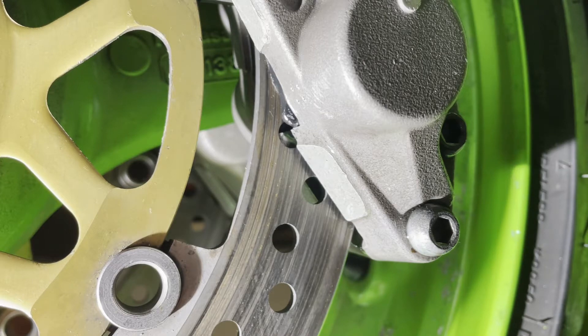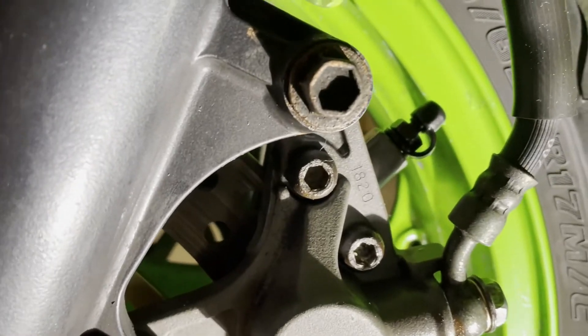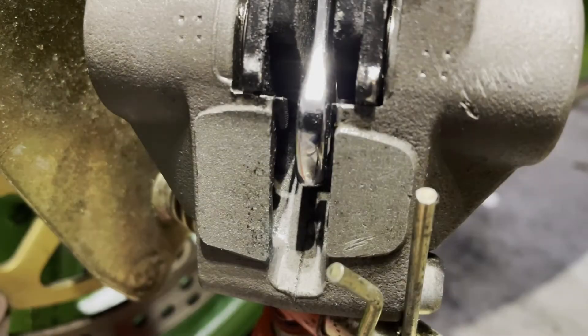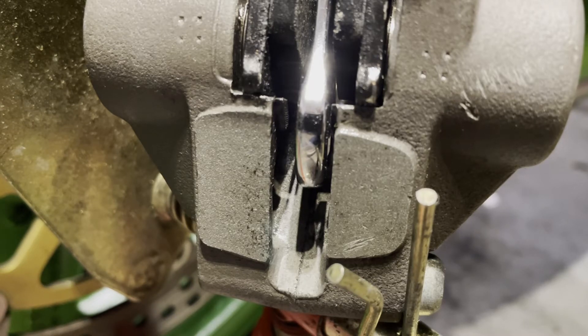So you've got both sides either leaking, or is it coming from higher up? The bleed nipple perhaps dripping down? What I've decided to do is take the caliper off the disc and just pump the brakes a few times to see if I can see any oil appearing. I've put a spanner in between the pads just to try and maintain some separation, because if I do need to get this off I'm going to have to put it back on again to crack the bolts that are holding the caliper together. Right, so let's give this a try - I'll pump the brake a few times and get some pressure in.